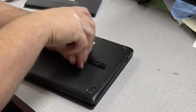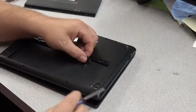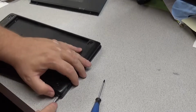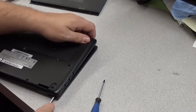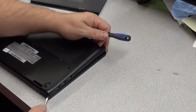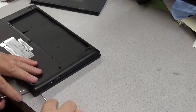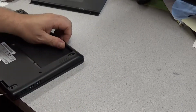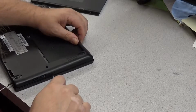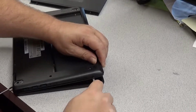And as you can see in the center of the battery area, there's 2. You don't actually have to take out that plastic, but it helps if you flip that lip over the prongs, so when you take the top off, it doesn't hook. Now I start from the back corner of the Chromebook to get the lid open. You have to have a very fine screwdriver or some other device to get in there. I'm not sure if I'm using the correct device, but it's a very fine flat screwdriver. And I start on that side of the hinge with the USB on that side, because the other side has audio, and the audio sticks out, and so you can't begin on that side. You have to end on that side and start on that side when you put it back on.